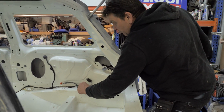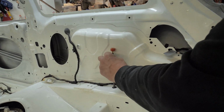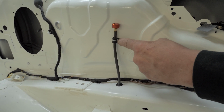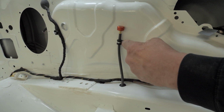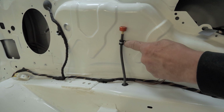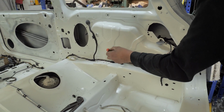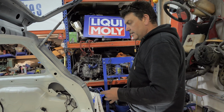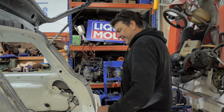So I've got the other adjuster through. Look on the other side. I've put a grommet in there, but I'm going to get a better grommet to neaten that up a bit, and then just put it on a P clip and bolt it through, probably with the same 6mm flange bolt we used to get the brake lines connected up to the clips, so they all look the same. And that all stays there, so you can adjust it. And that adjusts the stiffness and softness. So like 1 click, 2 click, 3 click. That's handy, isn't it? But I'll have it all right hard, I reckon. So the back end's all over the shop.